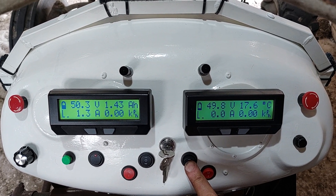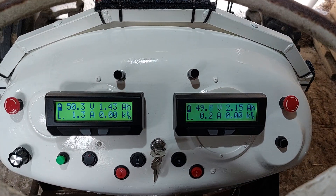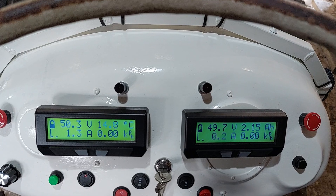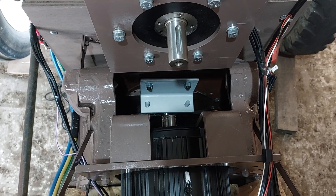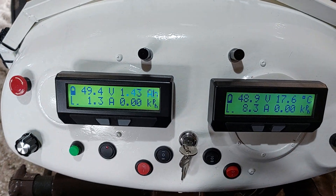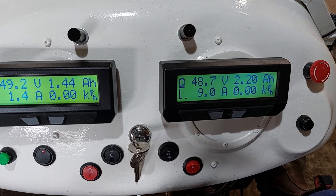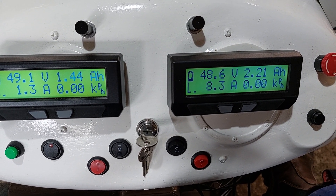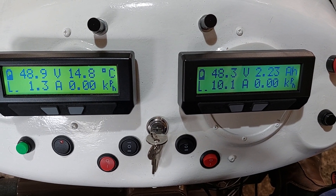You can hear the click of the contactor, and now that it's pre-charged you can switch it down to position two, which is the run state. You hear a little beep and it's good to go. I've got a foot controller for that motor, so pressing that now — you should hear the motor start. You can see the amps on the display: it's drawing around 8 to 9 amps just running at idle, probably around 2000 revs. Putting my foot down, the amps come up to 10, and obviously as it gets under load the amps will come up further.